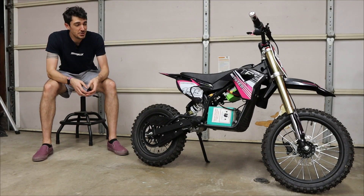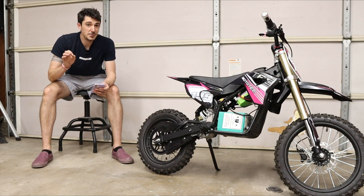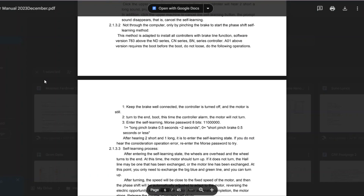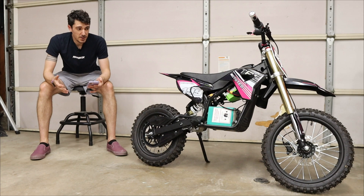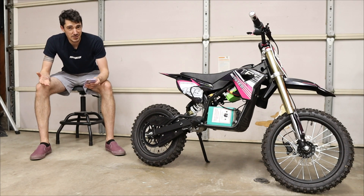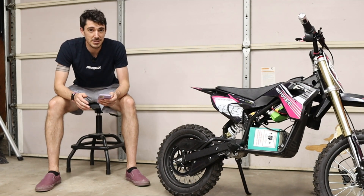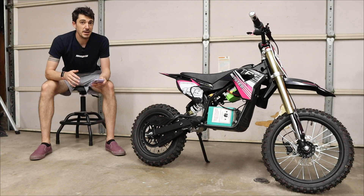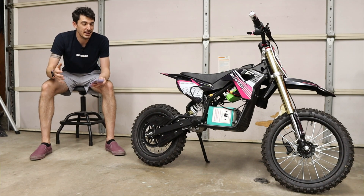It's been a few days now. I've had some more time to do some research and further testing on the bike and did not find much at all. I basically started combing over the parameters even more, going as far as finding a manual for the FarDriver app which has some rough explanations of all the parameters. First I found this thing called limit speed, which was set at 2000 RPM, and I figured maybe it's happening at 2000 RPM, so I'll maximize that — but nope. Then I thought maybe it was this thing called aN, which I still don't really know what it is, but it has something to do with the type of motor connected. There were conflicting opinions online saying whether it should be set at zero or 16, but ultimately it should be set at zero, which it was. I even went back to the phase offset, except this time having read the manual, I was changing it by just one or two numbers, not 10 or 20 — still nope.